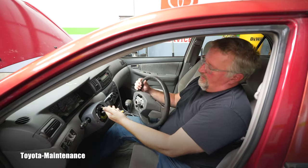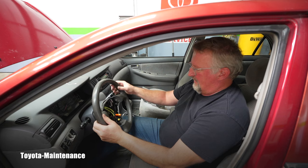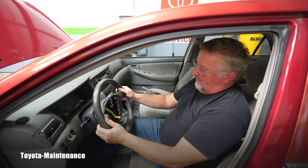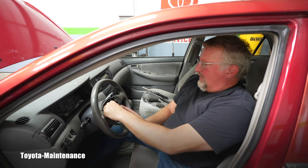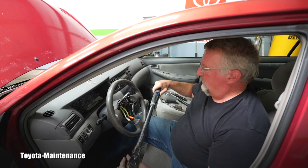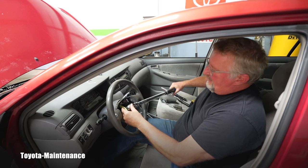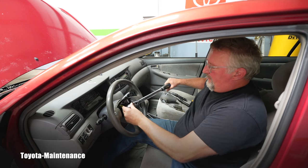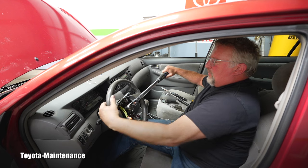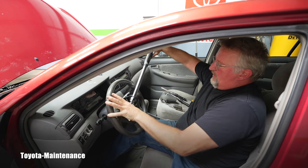Now I'm threading the steering wheel back, watching my alignment mark on the steering wheel and the shaft that we made earlier — that's why we made it, so I don't install it incorrectly. I can see it's matching. My source says this needs 50 Newton meters — 5-0. I have to be careful of the wires, and careful not to apply all the torque on the steering lock itself. We got to 49.4 — I think that's good enough.